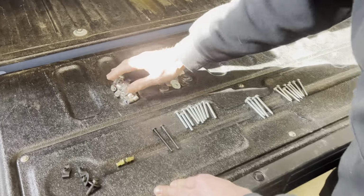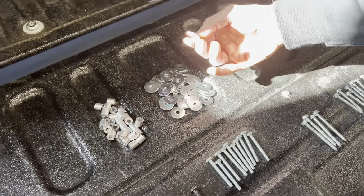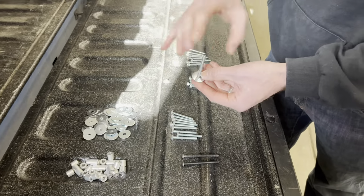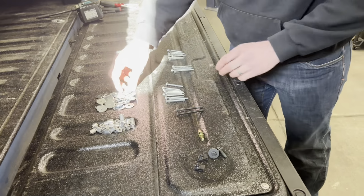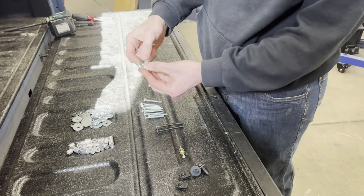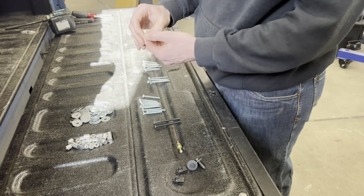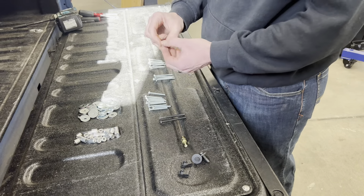And then we have a pile of 1/2-inch aluminum spacers, and then we have quite a few fender washers. And those fender washers are going to be twofold. One, they go on the heads of the screws to distribute the load across when we install them. But then also, we're going to use some of them as additional shims and spacers as we install this. And there are going to be extra washers in the kit. So that way, if you find that you want to add a washer or two to have it line up the way you want, then those are available. So don't be surprised if you get through and it's done and you have a few extras.